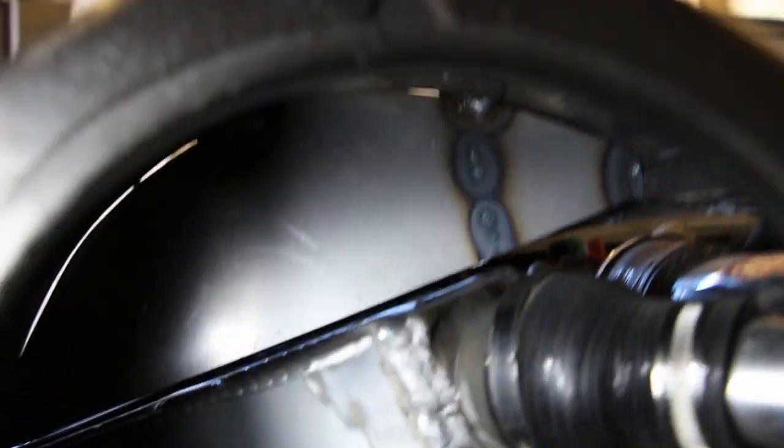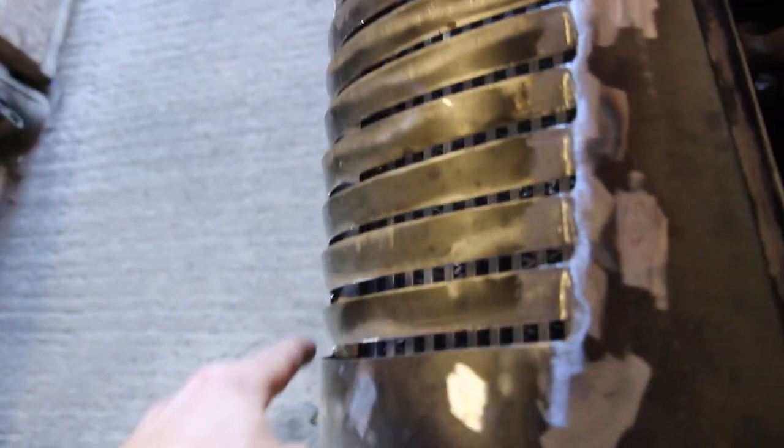So it's obviously quite tricky to show you how it looks in there, but hopefully you can see through the vents a little bit, and you can see up in there that basically will close the gap. Now there is a significant gap around the left and right sides, and that is because if you do a flush fit, it's fine if the wing went straight down, but it doesn't. It goes at an angle like that. So we'll do a double seal.